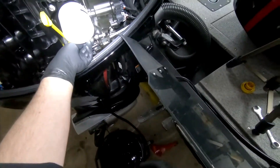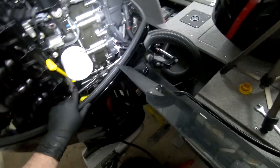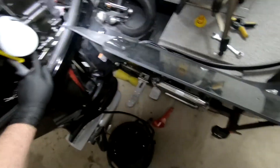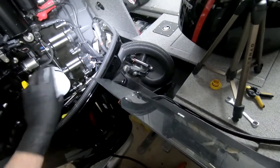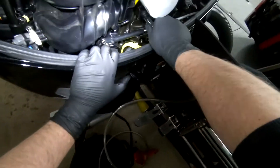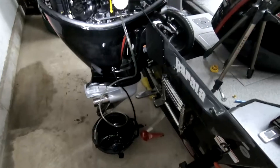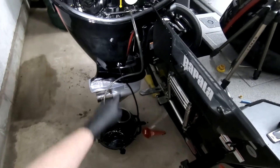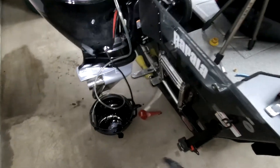The next thing — there's a little plug on the bottom here, and it's kind of cool because they actually put a catch pan under the oil filter. So when you take the oil filter off, just like the bottom end, you can hook a hose on here down to the drain pan and anything that spills out when you knock the filter off is going to go down into the pan. So let's get that set up — shove that on there, make sure it's snug. Now the oil is draining out into the pan. We're going to take the oil filter off — any excess should go into the second hose that will also drain into the pan. Let's pop this off, counterclockwise.